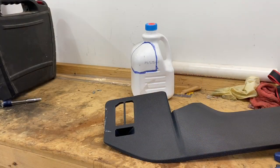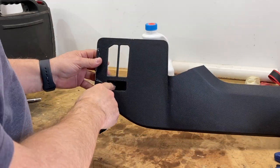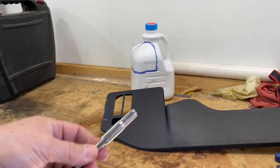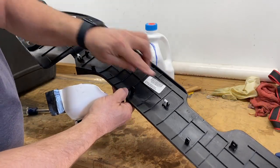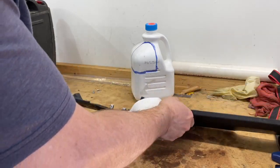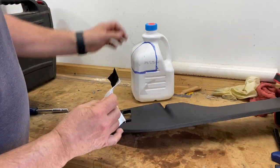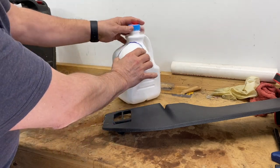It'll be a little easier just showing you. This panel comes out pretty easy — you got a bolt that goes right here. It is a 9/32nds socket. You can just pull that out and then you got a bunch of white clips back here that just snap into place — that you just snap out of place actually. You want your two flat surfaces so it meets this 90 up here, and you want your 90 here to be right here. That's the way it fits on the jug.